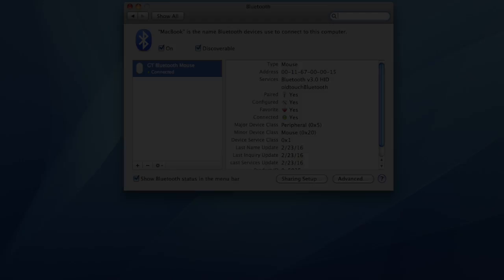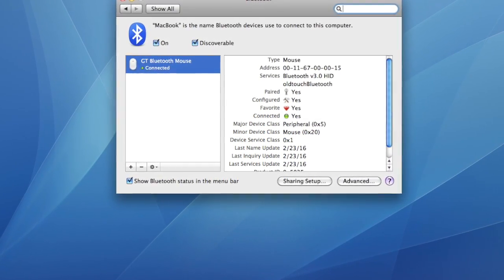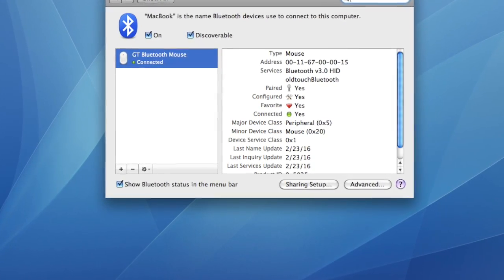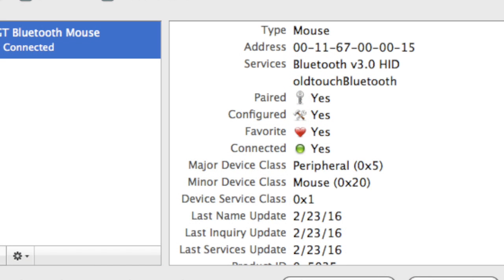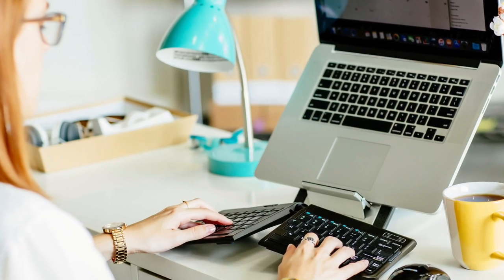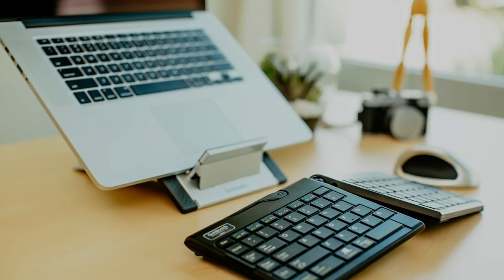Please note that on pre-Mavericks OSX, you need to ensure that you have added the Bluetooth device to Favorites. Select the device name in the device's section of the Bluetooth System Preferences and click the 'Add to Favorites' button, which is available under the cogwheel-looking icon. A red, heart-shaped icon will appear in the device's listing. If these steps aren't taken, the keyboard will disconnect after sleep mode and won't reconnect without a system restart. This setting is no longer required from Mavericks OSX 10.9.2 and later.